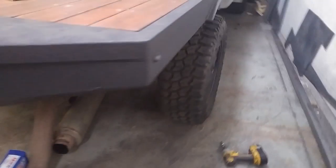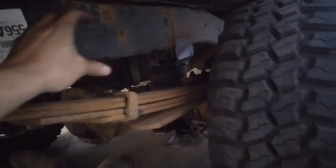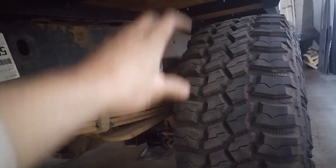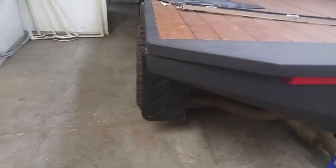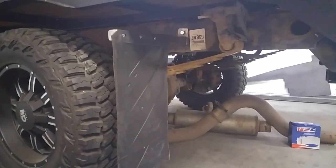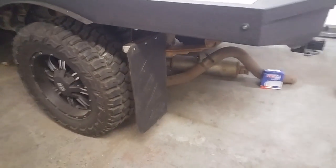It would sit much, much higher here because I was worried about it hitting on the leaf spring if the suspension is compressed a bunch. But I also don't want to have it super high up here because it doesn't really need to be. It's a little bit adjustable up and down, and I made it so that it can be changed either way. That should work pretty good like this. Simple, easy. I'll probably rip those off now and give them a coat of paint, and probably paint this thing too while I'm at it, because that will just start rusting if we start driving it right now.